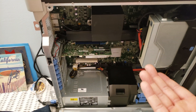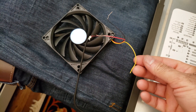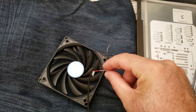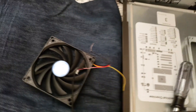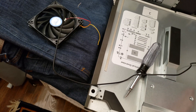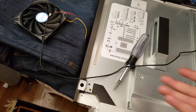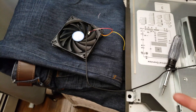This is like a 4-pin one. So what I do is I take this yellow one off — I'm not going to need it, so I'm going to cut it. And I put the red with the red of the USB, the black with the black. This USB cord right here came from a keyboard, an old keyboard that I wasn't using.